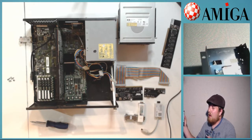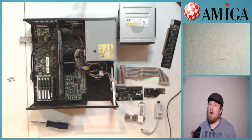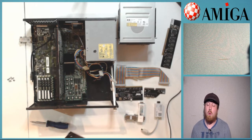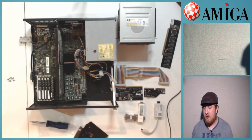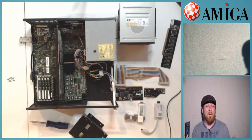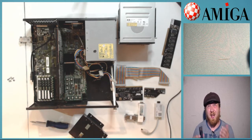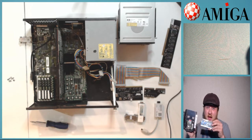There's probably no faster read, write, or access speeds out there outside of probably going with a Fast ATA, which, not going to get into too much detail or sidetrack, is another expansion card similar to the Buddha, but it has its own DMA chips and dedicated custom chips that go out to IDE, and it allows for IDE speeds up to like PIO 5 or 6, I think even 7 in experimental modes. And it's just insanely fast, but it's also like 150 US bucks. So without going to that, I think this is pretty much the fastest you can get.